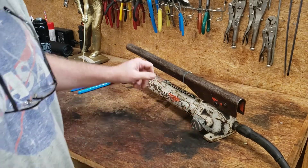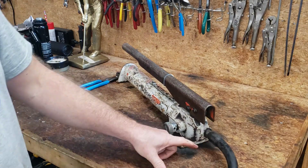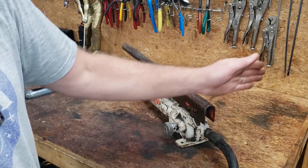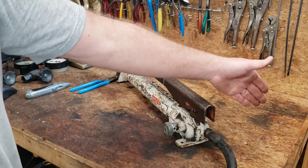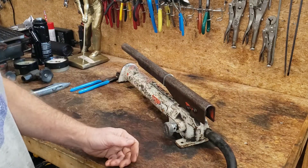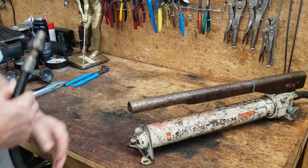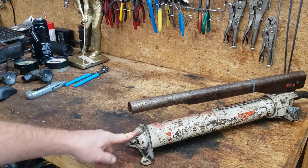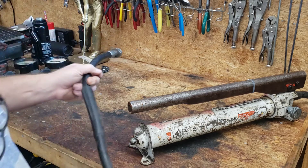The plan is to attach a T right here, attach a diesel injector pressure gauge, and T off to the injector. When you want to do testing, you pump it up, keep an eye on your gauge, observe the correct spray pattern, and observe where the injector pops by looking at your gauge. On the back side there's a port where you fill up the cylinder — I'll either fill it with diesel fuel and use it as-is, or fill it with some other fluid suitable for pop pressure testing.